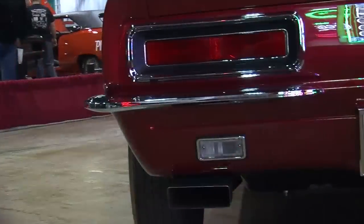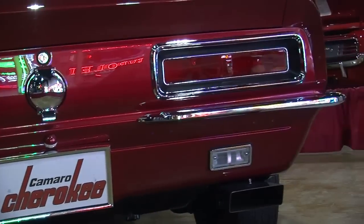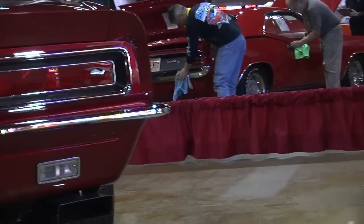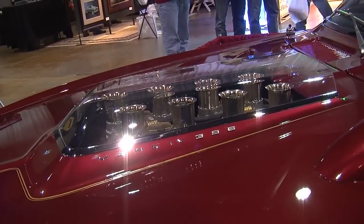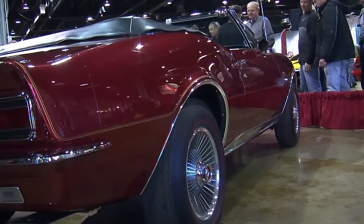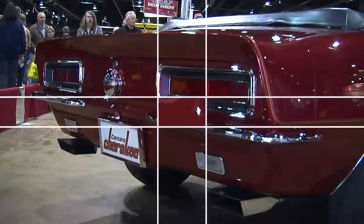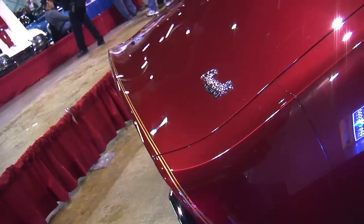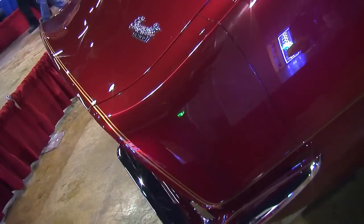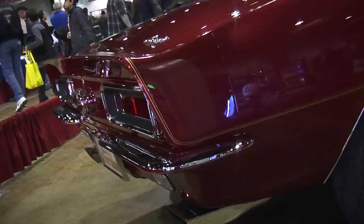With Bill Mitchell being such a Corvette guy, he did a lot of Corvette influences. It's got Corvette-style split front and rear bumpers. It's got a Corvette-inspired hood with a clear hood scoop, which is cool because it shows off the factory-installed moon intake with the Weber carbs. And as you go down the car at the back, you'll notice they cut the back eight inches of the quarters off and built fiberglass quarter extensions with a real low-profile spoiler, plus a fiberglass decklid skin with that same spoiler. When you look at that side profile, it's '68-'69 Corvette all the way through.